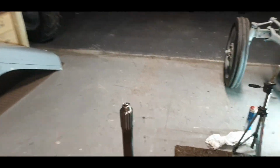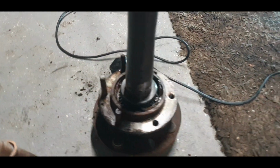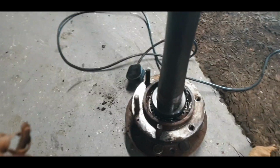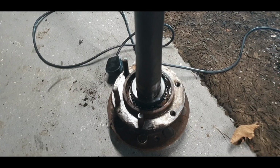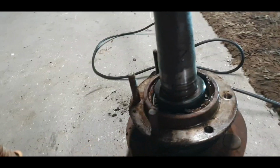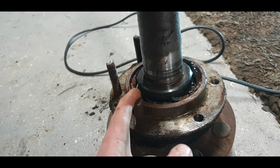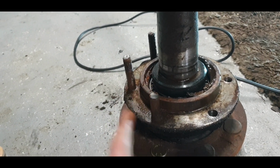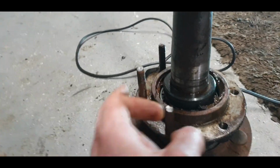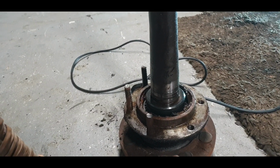So what I'm going to do now is return to this half shaft. We have to take out one of these studs, leave in two. And we're going to have to fix, oh yes, this one here had to be cut off. That was the one that had to be cut off. I've never seen a nut as bad as that one of these before in my life. So that's going to have to come out. We're going to take out one of them, maybe put it across from each other to help us line things up, and we're putting them back together.